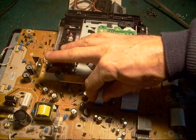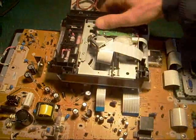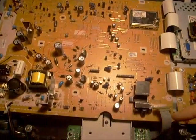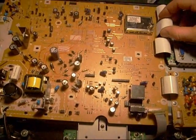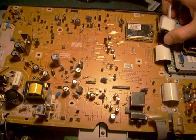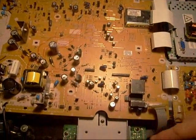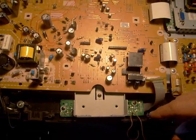What I started doing is I began pulling out different ribbon cables. I disconnected the DVD player first while monitoring my standby voltage. I noticed that didn't help, and then I tried pulling off these other ribbon cables going through this other board. The voltage came up a little bit, but it was still way too low — still less than a volt across my standby power.